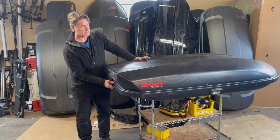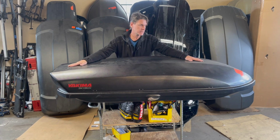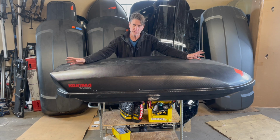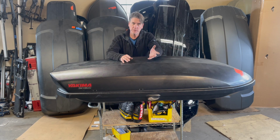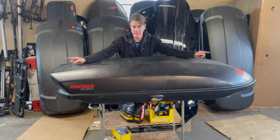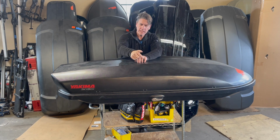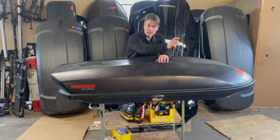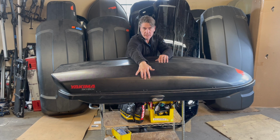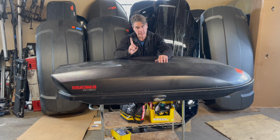We're going to get started on this one, but first we're going to unscrew both of the hinges. For these boxes, it's just a number 2 Phillips screwdriver. That's all we need to be able to take those off. We also do the Thule boxes, and if you watch some of our other repair videos, you'll see how to take the lids off also. It works best in this box if we have 2 keys. You can put 1 key in, open it up, disconnect the hinges, and then put the other key in the other side, and the box will literally flip over. But there is a way of doing it with just 1 key: you put the key in, disconnect the hinges, and then activate each of the connection points where these rivets are, and then you can take the key out and bring it to the other side.